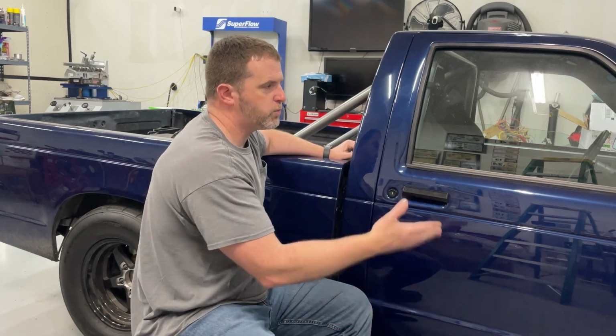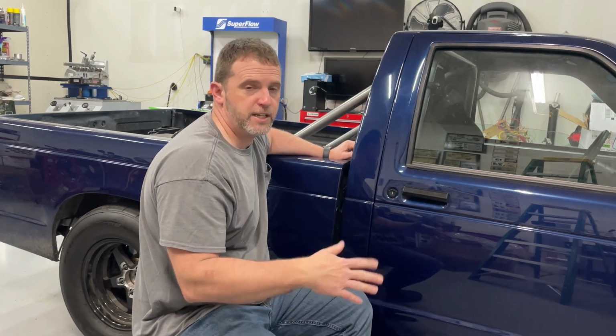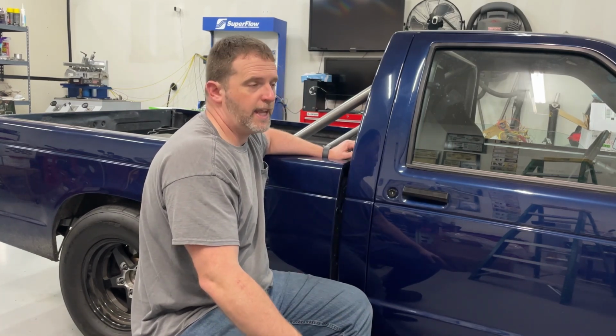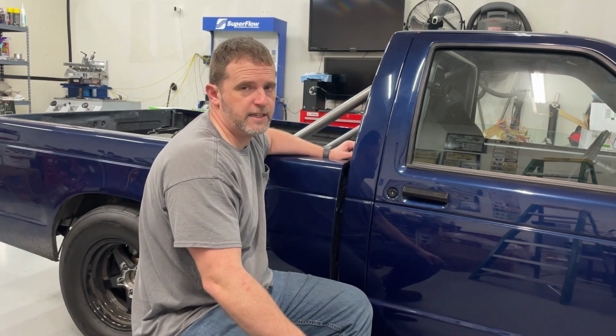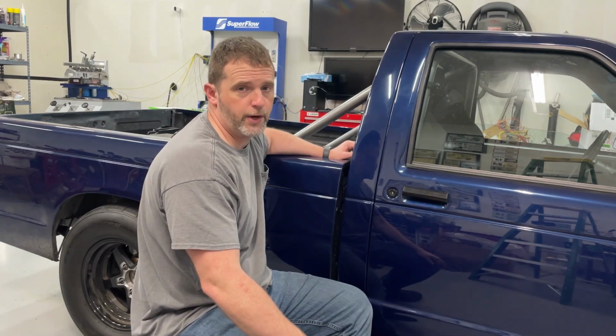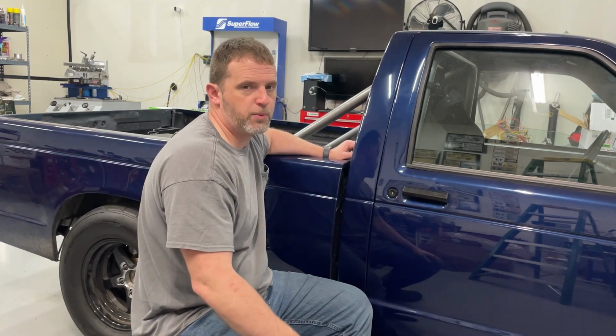And what I mean by that is when the engine first went in, I had different headers from what was used on the dyno, and I had a full exhaust system, and it went 1162 at 118. It didn't even show close to 500 horsepower. It showed closer to 400. Now, granted, the headers and stuff will probably lose it.